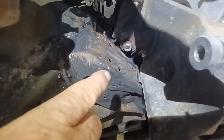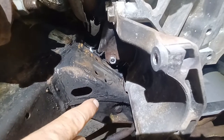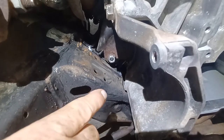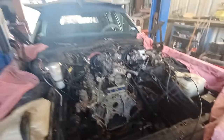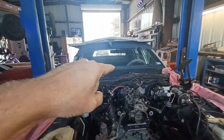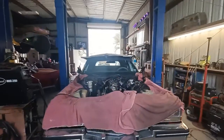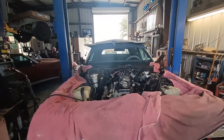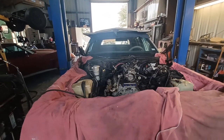It'll just be a pocket right there, welded back in so the AC compressor can go in and out without any problems. I watch a lot of videos of these swaps and there's never any AC compressors - I guess you guys live where it's 72 degrees all day long, but us guys down south have to have that AC. Got the engine mount set. The transmission shaft is lined up with where the linkage would go to shift from the steering column - and since this car already had a 200R4, it already has a four-speed shifter, so that problem is already taken care of.